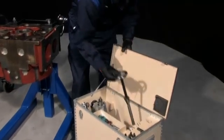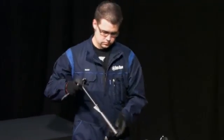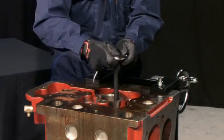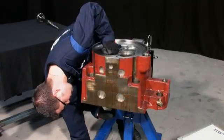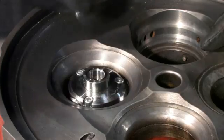The VSL is easily set up and operated by one man. Begin by cleaning the valve guide with the provided cleaning tool — this will assure that the VSL is perfectly centered. Then secure the self-centering pilot spindle inside the valve guide and mount the VSL on top.